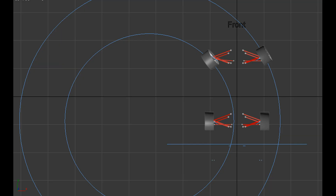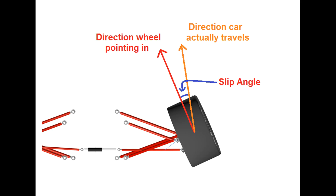Although almost every production car follows the Ackerman steering geometry, in racing you would often see race cars going with a geometry opposite to this — meaning turning the outside tire more than the inside tire — which is called anti-Ackerman. To better explain that, I first want to explain slip angles, because it will make a lot more sense after you understand slip angles.